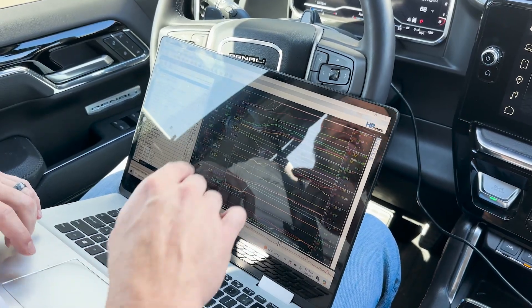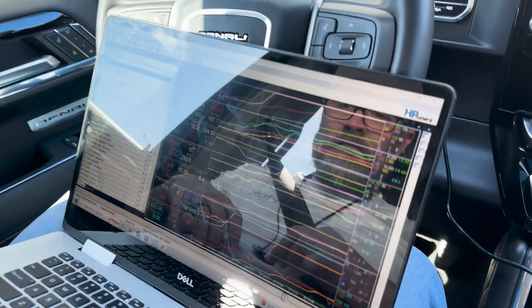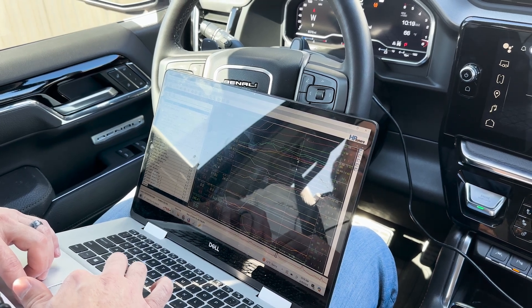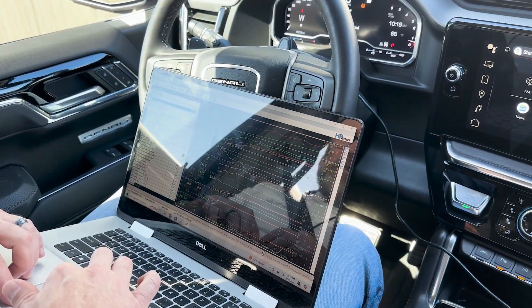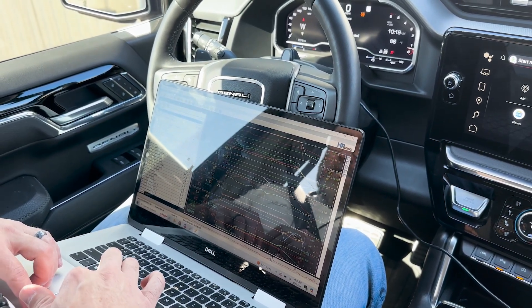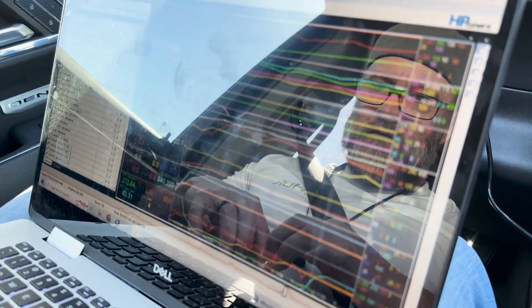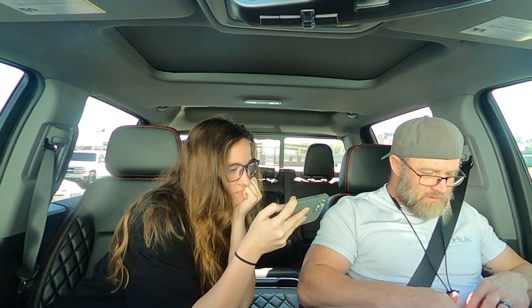All right, what's this looking like? Delayed in opening the throttle down low. This orange line is my pedal — my accelerator pedal input. The white line is what the actual throttle on the truck did. So it was definitely slow opening the throttle; I'm going to have to work on that. The fuel side of things looks pretty good. The 1-2 shift was short — it shifted at 4,400 RPMs. 5,600 on the 2-3, 5,600 on the 3-4, like 5,300 on the 4-5 shift. Everything else data-wise looks pretty good — about 7.2, right around seven to seven and a half pounds of boost.